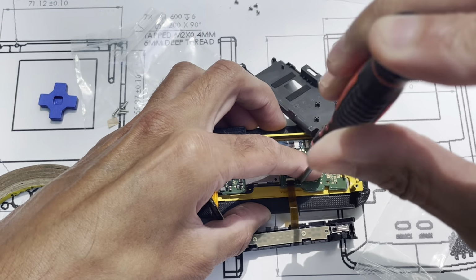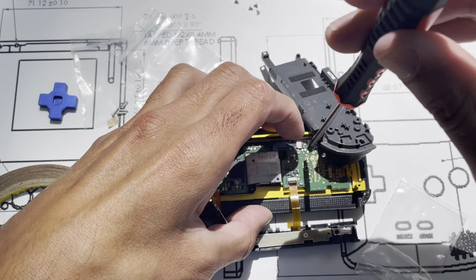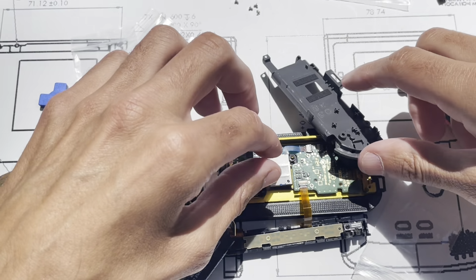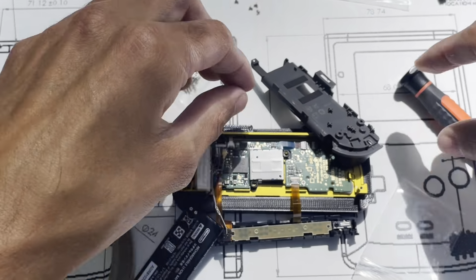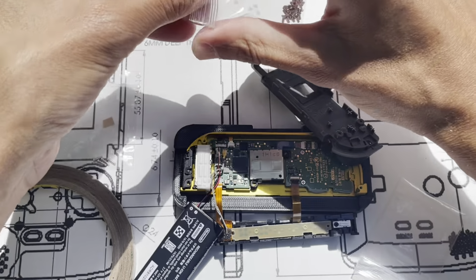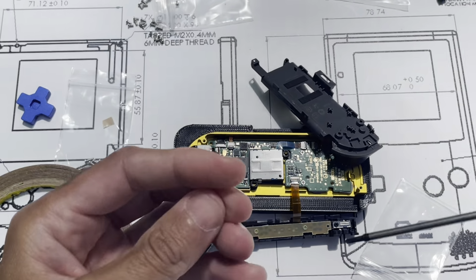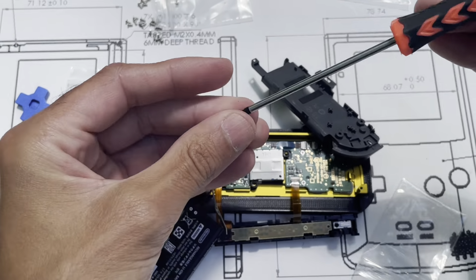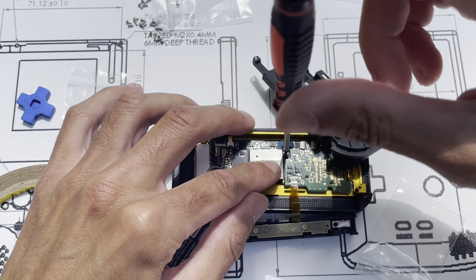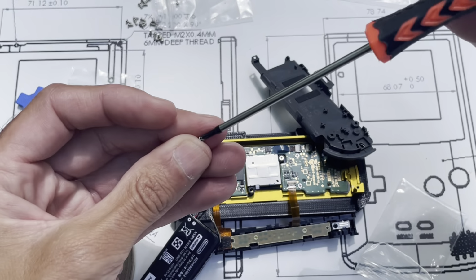And by tighten, I don't mean tight. I don't have any torque specs, but it does not need to be tight. They're metal, they're machine screws. Machine screws are completely different than plastites, right? Plastites take some force because they're cutting their own threads as they go in. These are machine screws. It should feel smooth. You should be able to turn it with your fingers like I'm barely even putting any effort into it as I do this, for example.